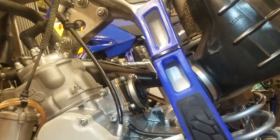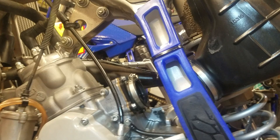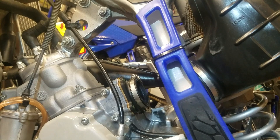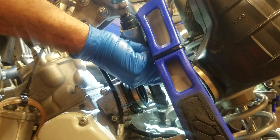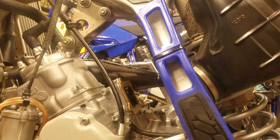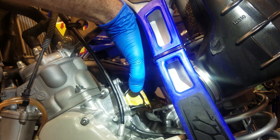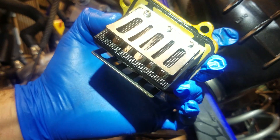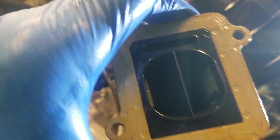Let this air ratchet do all the work for me. Got the intake boot right here, got some dirt on the edge - we'll take care of that. And the reed cage - let's go ahead and slide that out. Quick glance: does not look like there's any chipping or anything. Let me hold it up to the light - stick a light behind it and see if we can see light through any cracks. Maybe here or there, but nothing major. They're actually looking really good.